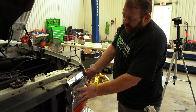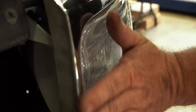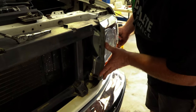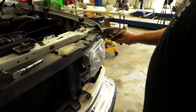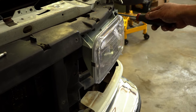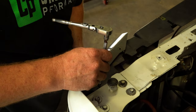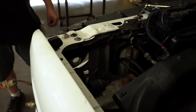Before going further, bring the headlight out flush with the bezel. While holding the bezel in place, bring the face of the headlight out flush with the turn bar face, clearance light face, and bezel face — that'll help with final light adjustment. Use the adjustment screws: counterclockwise brings the headlight out. You have top-left, top-right, and a third screw that raises the bottom of the headlight.